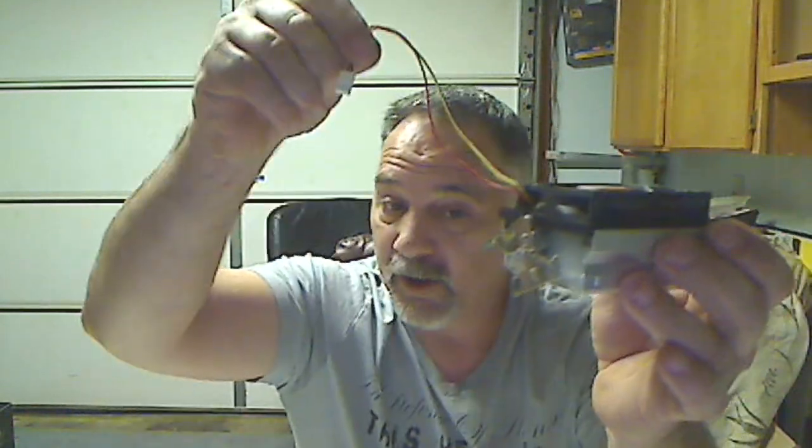So it's really important to open up your PC, take the compressed air cans, make sure it's unplugged, of course, and blow these fans out. I like to clean them with an old toothbrush, and make sure you blow all the dust out of these fins. This is just a real rudimentary procedure to keep your PC running smoothly. You do not have to take this heat sink off. You do not have to unplug the fan off the motherboard. It'll just be sitting in there. You hit it with the compressed air, blow it all out, clean it up, fire it back up, you're good to go.